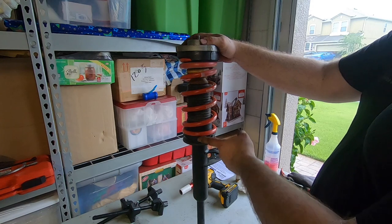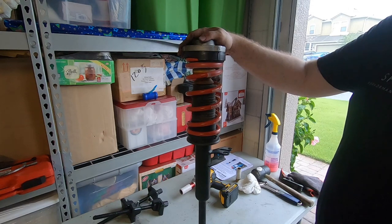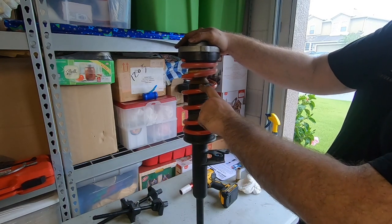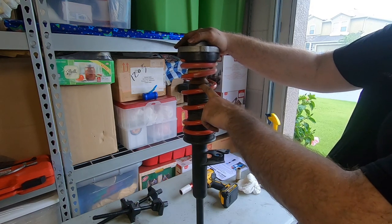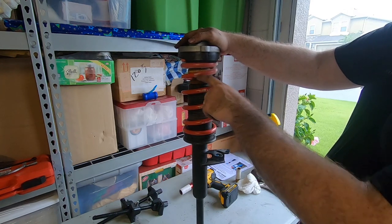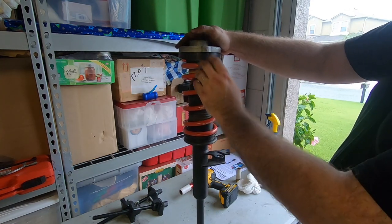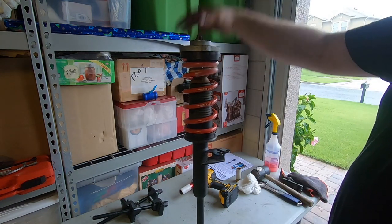As you can see, it is back on. Released the spring compressors — the rubber is sitting exactly where it needs to sit, and you have the ability to tweak it a little to line it up. This is an M Sport, and on the M Sport it sits a little lower than the regular 550. So when you're buying springs that say they'll lower by a certain amount, it won't lower quite as much because it's already on a suspension that's a little lower than normal 550is.